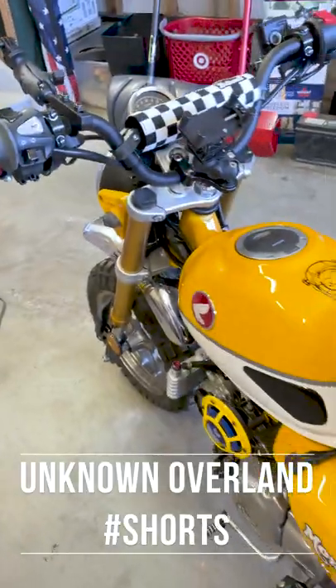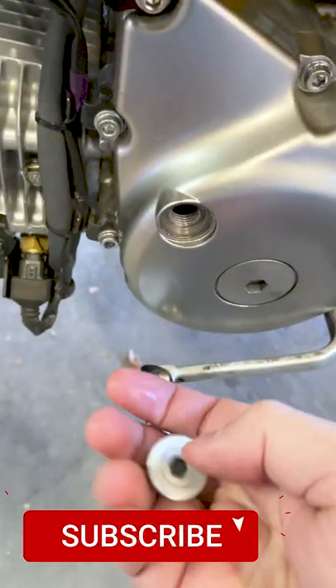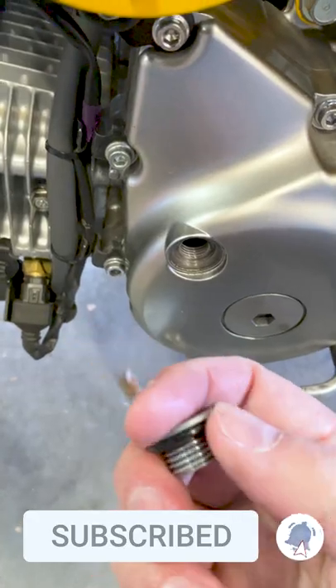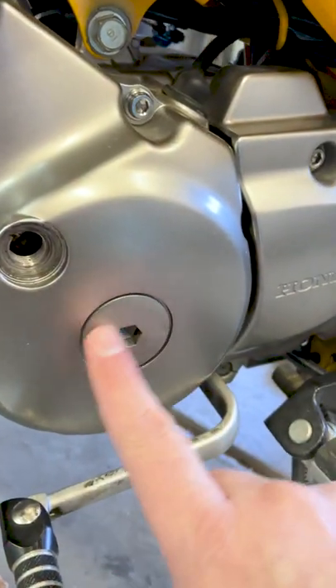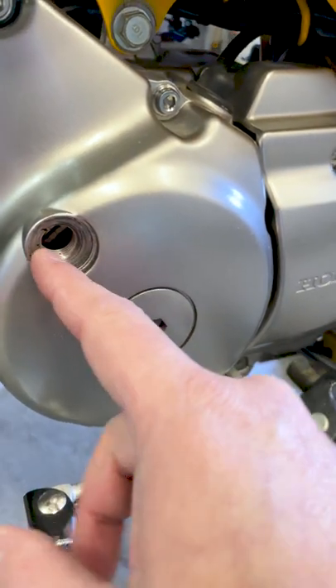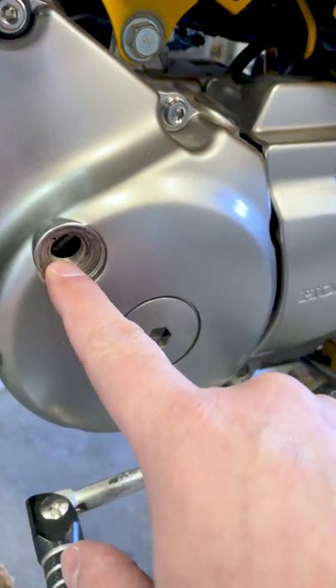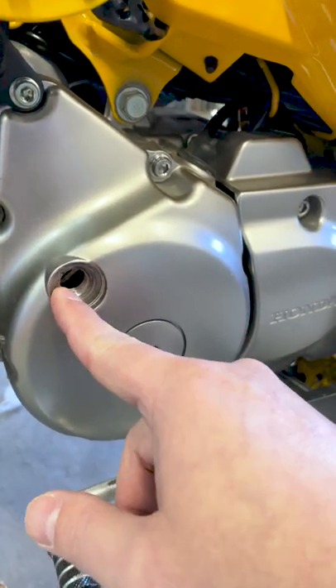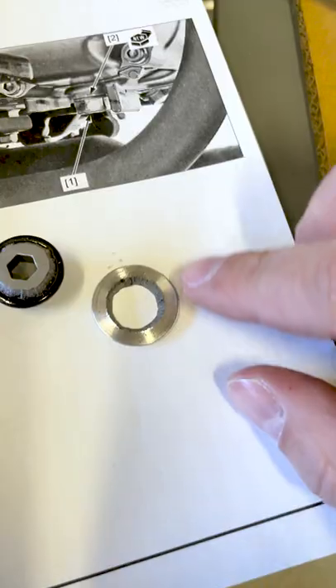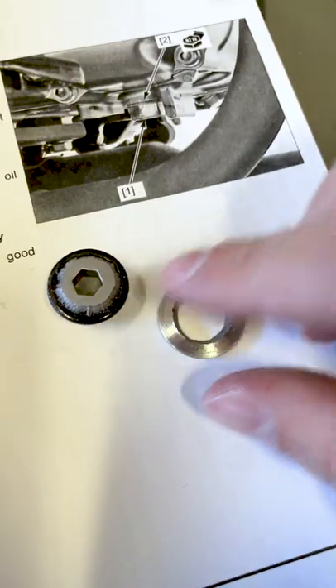Hey, what's up? I'm Unknown Shadow, and that's Albert. Recently I had to learn the hard way about torque and these timing hole caps. They've got this lip around them and an O-ring that kind of sits right in here. When you start torquing them down, it's actually putting a lot more pressure on this outside lip than it is on the threads themselves. Too much pressure out here and it just kind of ripped right off. So instead what we're going to do is talk about putting on the replacement, swapping that out, and focusing on what the right torque should have been.